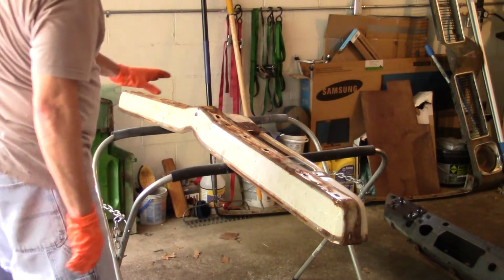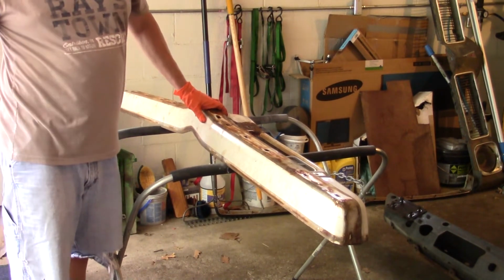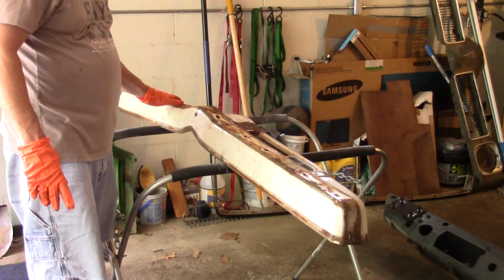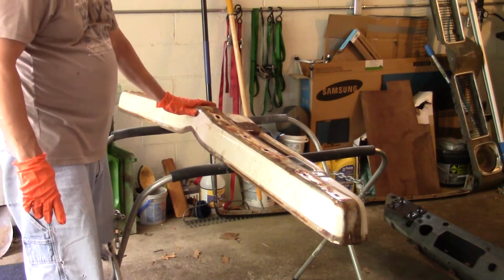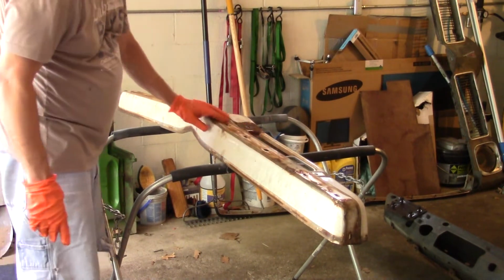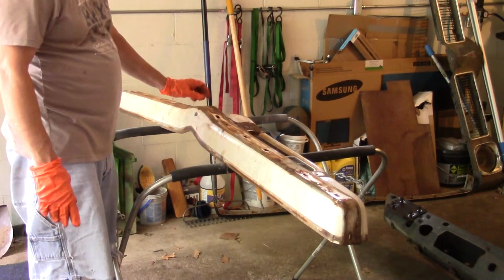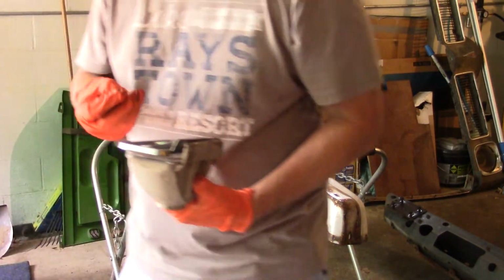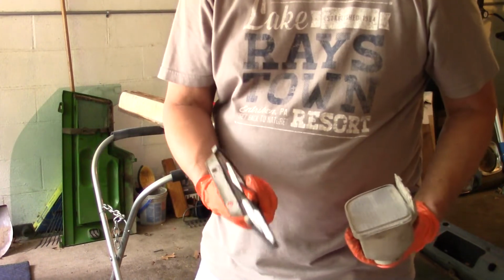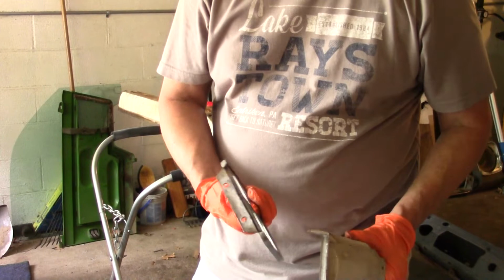You know what's going to be nice about this? You got to kind of be gentle with sheet metal, because if you get too hot, it'll warp on you. But I can go to town on this thing. Put some 36 grit sandpaper on it and have that all cleaned off. Get some etching primer on it in no time at all. I thought these were plastic. That's aluminum or steel. It's got some heft to it.